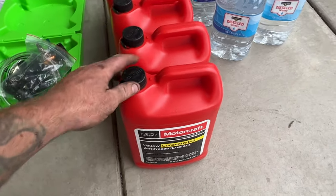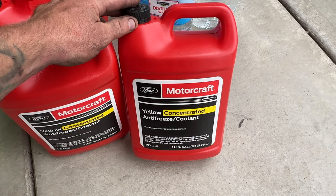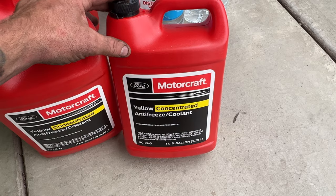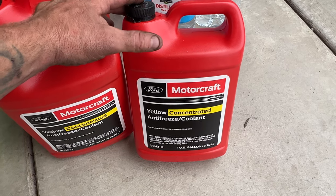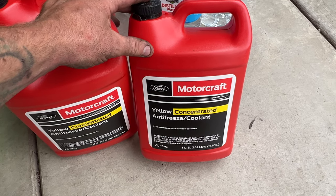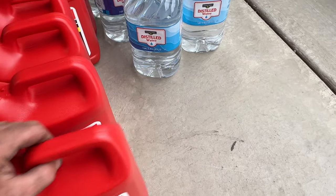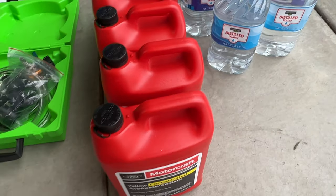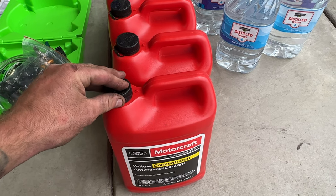The main reason I wanted to get all of that orange coolant out of the engine block is because Ford recently made the switch to this yellow coolant. They do not make the orange coolant for this vehicle anymore — Ford has switched to the yellow, which they are using in the majority of their vehicles now. They do say that you can actually mix this with the orange with no problems, so if you got a little bit leftover in your engine, do not worry about that. I also got quite a few gallons of distilled water, which I'll be mixing with this stuff 50/50. I'll put a link in the description for that as well.